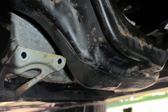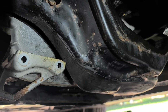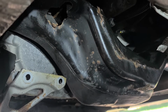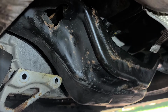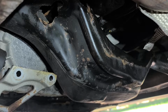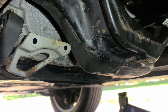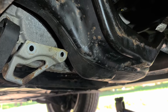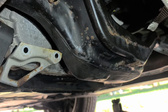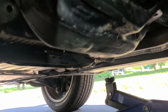But I know there's quite a few videos out there. Some are for pretty much the 6-cylinder engines, but I didn't see any that's made for the 4.8. So I just wanted to make this video that may help somebody out as to how to take that out and replace the motor. So if you have an all-wheel drive light that's on, DSC light that's on the dash, it says VTG box malfunction, most likely the problem is the control unit.